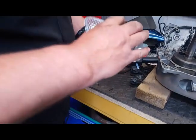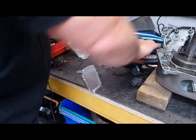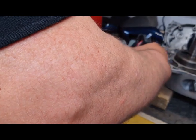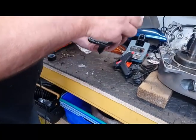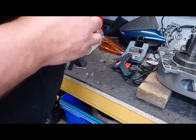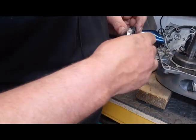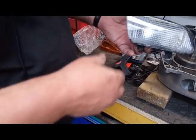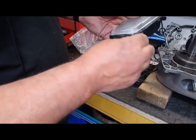Just push it on loosely initially to make sure it all lines up and fits. Take the glue gun and put some squirts in — you've got to be fairly quick because this glue will go cold. Then line it up — we've got our line-up tags at the top and bottom — make sure they line up and pop it in. Don't be worried about applying a bit of pressure, the plastic will take it. There we go — one lens glued on. Squish it a little bit more until the glue goes off. And that is literally how easy it is to change lenses.